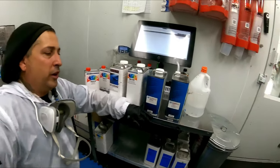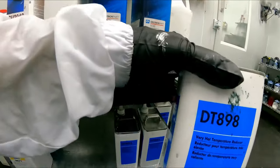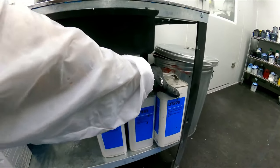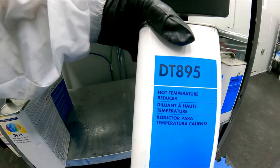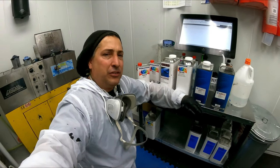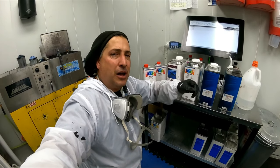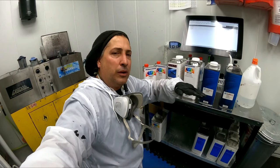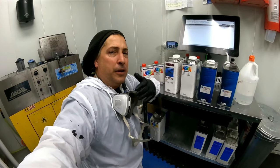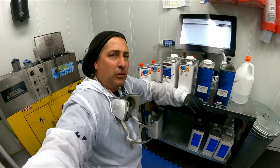So we're going to clear this one today with the 2021 with the 98. I was using the 95 — that's what they recommended — but it's doing a little bit of micro popping. So we're going to go with the very hot reducer and try to eliminate that and get this thing to flow out real nice. I like to have a clear, especially with these glamour clears, that you don't pound on. You let the clear flow out on its own — just put a nice medium coat, then another medium coat, and this thing will just level out.